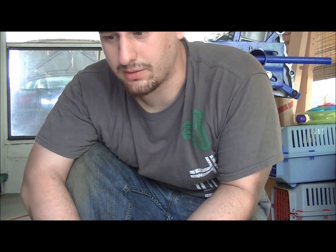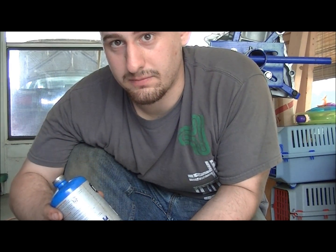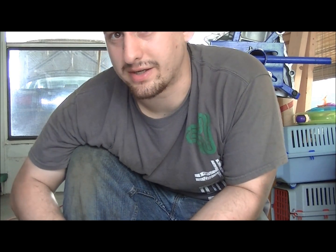The first thing you want to do is spray penetrating oil on the bolt and let it sit — let the car sit overnight, or at least a couple of hours. Then, only if you can't get it off, use the torch, because heat can actually make things worse by driving rust into places you don't want it.